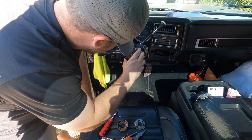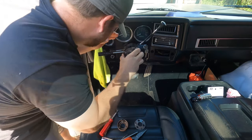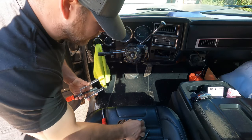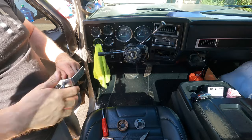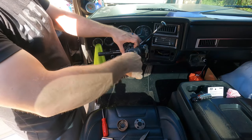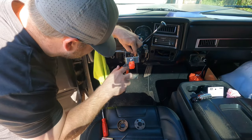Then we will get our lock plate - you kind of got to fiddle with it until it starts to go on there by itself. Don't want to force it on there. Then you will need your lock plate tool again, but before you put your lock plate tool on, you need to put your retaining clip on first - trust me, I forgot that many times and had to go back and redo everything. Once that's screwed on, you can start sliding your nut down for the mechanism. Once you get it on far enough, you can start going back on with the lock ring.